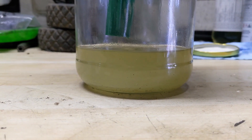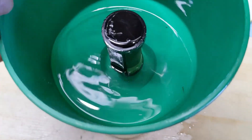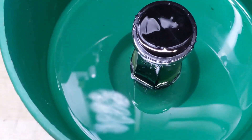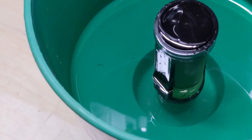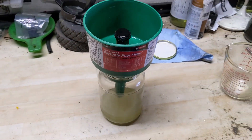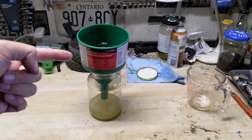We can see we're getting just about to the end here — check out all that water! It looks pretty clear to me and you can see a whole bunch of floaters in there, all kinds of nasty stuff — tiny little bits of gunk. See that little piece in there? That would be just enough to clog a pilot jet, and then you'd get surging on your lawnmower. The thing wouldn't want to idle and you'd have to be revving it out all the time — maybe your mower only cuts grass under load. A little piece of gunk in there.